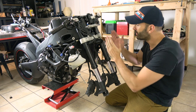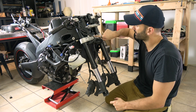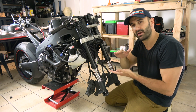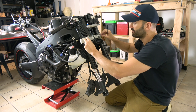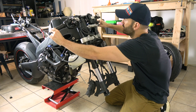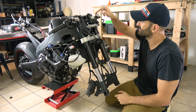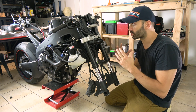What we have now is: the only thing that is tight is the lower triple clamp stem in the frame. Those nuts right here just put the bearings for the steering under compression - that is it. Everything else is loose. This is completely loose, not even finger tight, and the same goes for the clip-ons. The upper triple clamp right here is just resting on top - nothing is tight except those steering bearings.